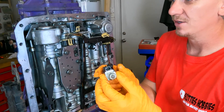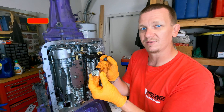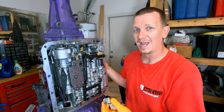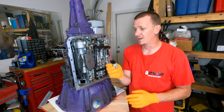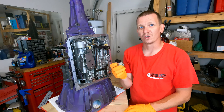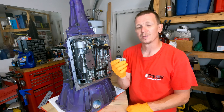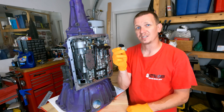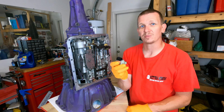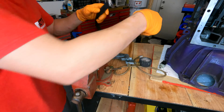When there's no power applied to this solenoid, fluid flows through the valve body and out of the little vents on the solenoid. When the computer gives it power, the solenoid shuts, allowing pressure to build up in the valve body, causing the valves to move and making the shift happen. When you replace these solenoids, make sure you get AC Delco only — I've heard horror stories of using non-AC Delco solenoids and having to redo the job. There will be AC Delco part numbers linked in the description.